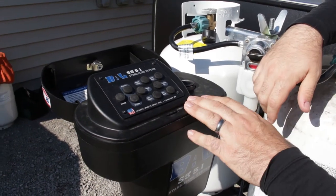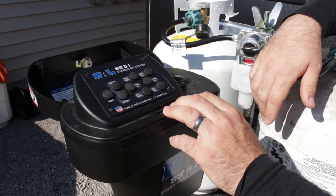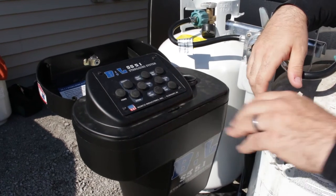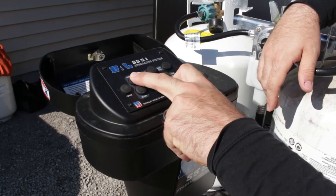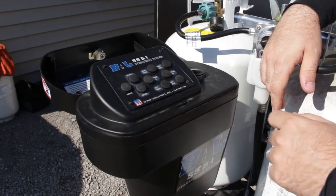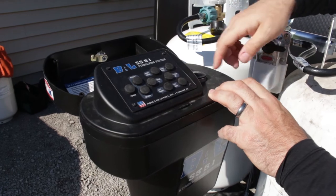This is all this is for. You don't want to overextend it — you will most likely blow a fuse by putting too much pressure on there. If they extend too far it can also blow the fuse, so make sure to add extra blocks underneath to stop them from going too far. To retract them, just hold it until they come to a stop. If for some reason you lose all power or the motor is dead, you can individually manually operate each one.